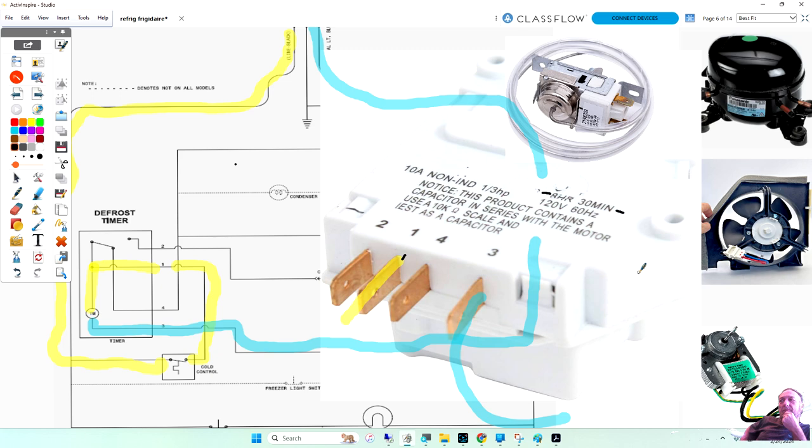It'll defrost sooner, but go back to the note that we said, look, the thermostat sends power to this timer motor. So when a thermostat says the fridge is cold, it's open, your timer's not running. So even though it says 8 hours, that's not 8 hours by your clock on the wall, it's 8 hours of compressor runtime. Where a compressor runs an hour and shuts off, I still got 7 more hours of that compressor to run before it will go and defrost. Okay?